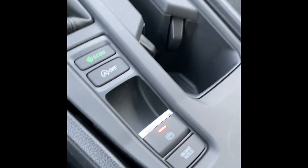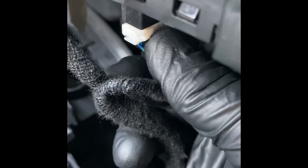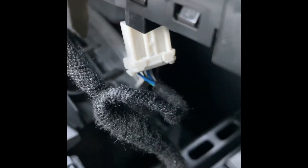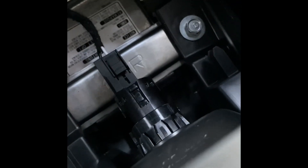What we're going to do is get to the bottom side of the idle stop off switch here. We're going to lift up on this panel as it's loose and unplug the wire connector underneath here. It's this little wire connector — you're going to push the little latch tab in and while you hold it in, pull down on the connector. It'll pull right out. The next connection we're going after is the console 12-volt power socket down here.